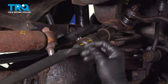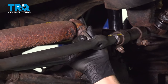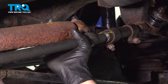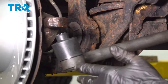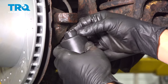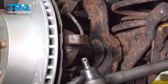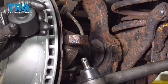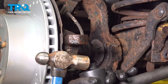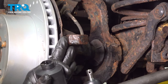Now that we have our lines lined up, I'm going to pre-assemble these components while things are up and out of the way — it'll help us fit things in here a little bit easier. Pop that in. On the outside end here, we have a protective plastic cap — remove that and go ahead and pop the nut out; you can discard it. Now our ball joint here is pretty tight because it's new and it's going up at an angle. I'm going to install this little cap to protect the threads and work the ball joint so that it's facing up and into the knuckle.